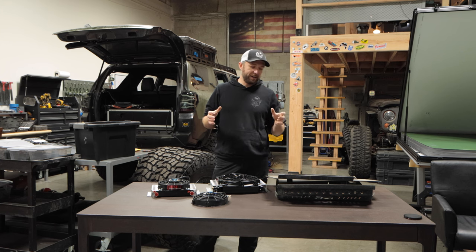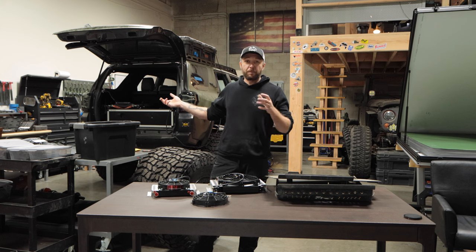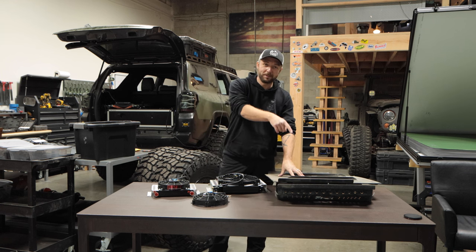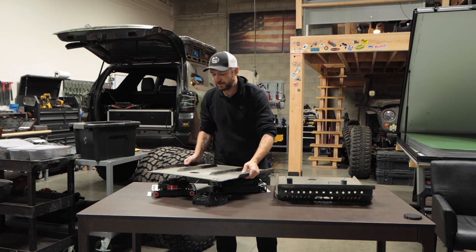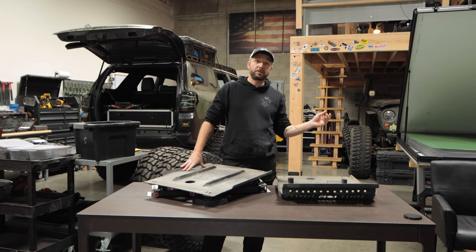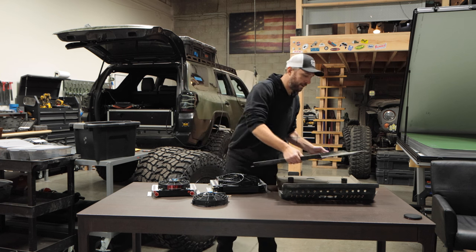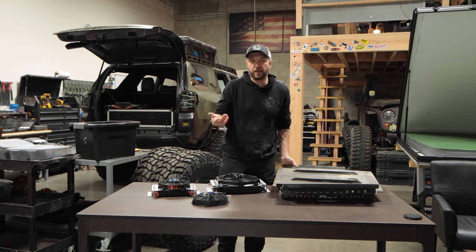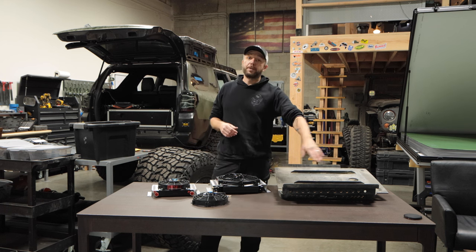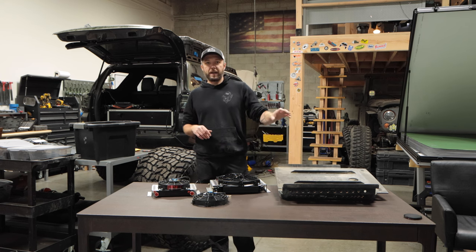The third thing is blocking airflow. When I installed a full skid system, I didn't realize how much airflow from the factory design I was blocking off. On my first skid system — the RCI skid — I had to drill a ton of holes. All those holes actually helped drop my temperature by about five degrees. A lot of skids do come with holes in the front and slots on the sides. I recommend getting those, or if you already have something, start drilling.